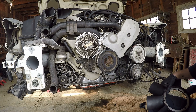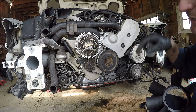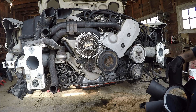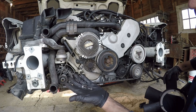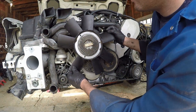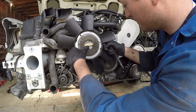To install your cooling fan on your fan clutch on a 1997 to 2003 Audi A8, it simply takes the three H5 bolts that you have in the cooling fan itself. You'll want to line up the holes, push it back against the clutch so it's nice and snug, and a little bit off center here.